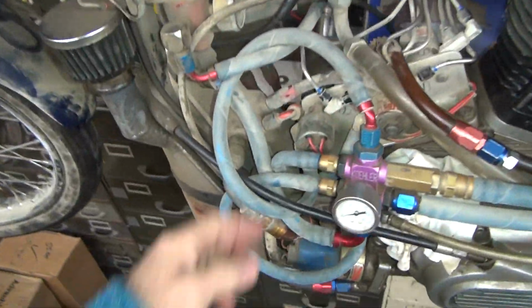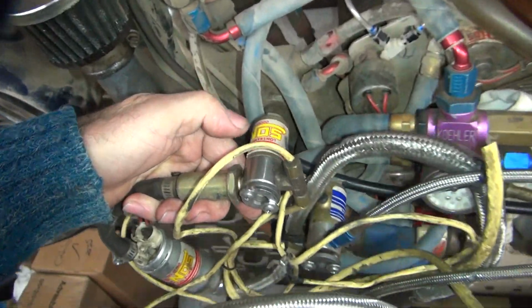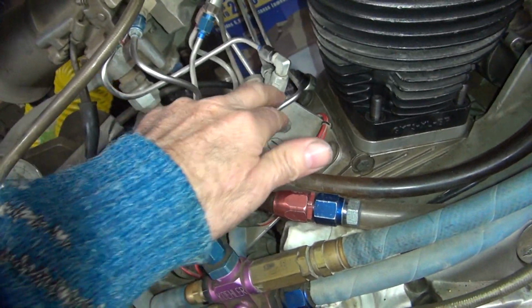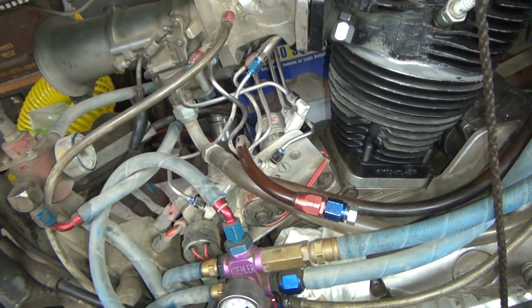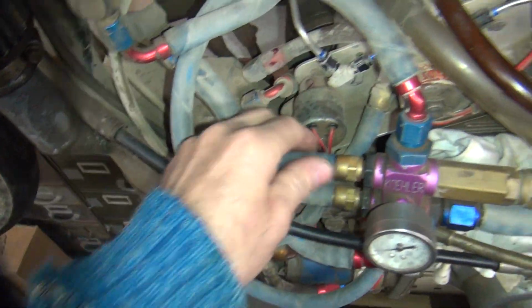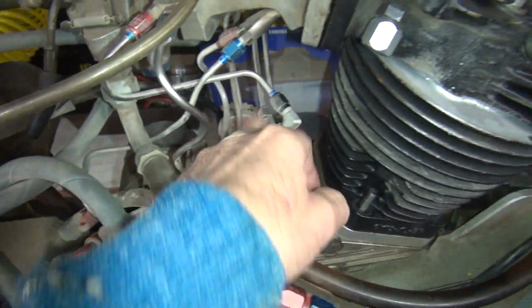So there you go. Now I use big solenoids. See, mine are next size up. And these are little dinky things here. These are little Maple Leaf ones. See, Maple Leaf big ones. See, big difference. So me, I'm using a 3/8" fuel line feeding them, and then we have our stainless steel tubing coming out to feed everything with. And the nitrous obviously is the one here. So these are both fuel on this side, and nitrous is on these other ones on the other side. Those are nitrous over there, the blue ones.